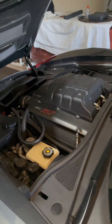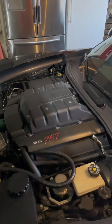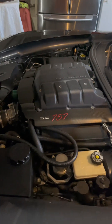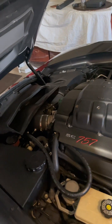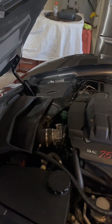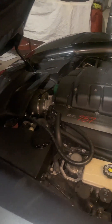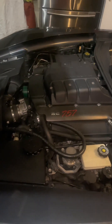The key point of what makes it a Callaway is the supercharger. This is a 2.3-liter supercharger — definitely an upgrade from the smaller 1.7 that comes factory. It makes 757 horsepower, though I believe it makes a little bit more. It was a jump up from the 570 originally dynoed, which I believe was a tuning issue. Besides the supercharger, it comes with a bigger intake and cooling mods — the intercooler and bigger fans — and I've upgraded those to a bigger size. It has the Cordes Ice Tank and the Mighty Mouse Catch Can, which helps the IATs drop down a lot more and makes more power.